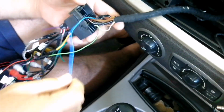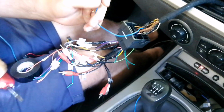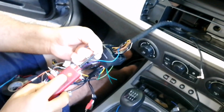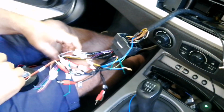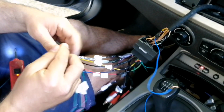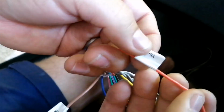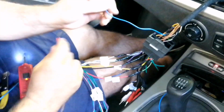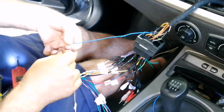Bring it back over with the ignition wire. Okay, once we've connected up there, we're obviously checking again that we've got power. That would be putting on the lights. Put on the lights. Okay, see, we still got the power. Now we find our illumination wire again. Show me that. What is that? Pink, red? It's normally an orange wire. Orange. Yeah, illumination. The international code for illumination would be an orange wire. So we're going to connect up the illumination wire.